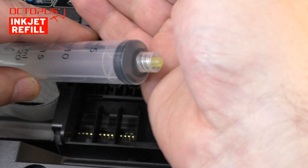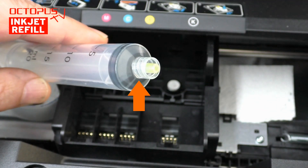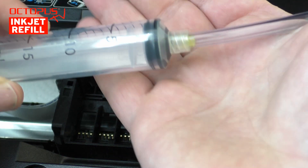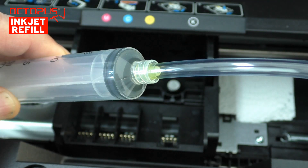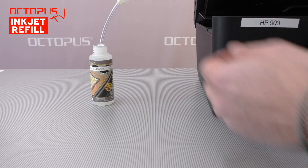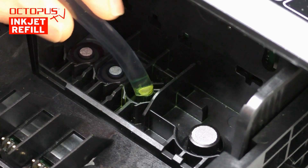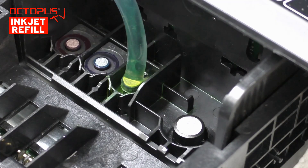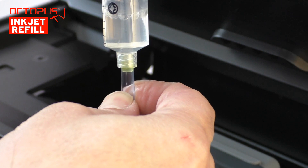To clean the ink port of the yellow pigmented ink we use a piece of thin soft plastic hose. This thin piece of hose is connected to the central piece of the Luer lock connector on the refill syringe. Please be aware that the hose is held on the syringe just by friction — pressing the syringe plunger too hard during cleaning can cause the hose to slip off the Luer lock connector. With the plastic hose attached to the syringe, draw in nozzle cleaner from the bottle. Set the soft plastic hose filled with nozzle cleaner onto the ink port straight and carefully, pressing the tube on while twisting it from side to side. Remove any remaining air bubbles in the hose by pressing on it and moving the bubbles into the syringe.